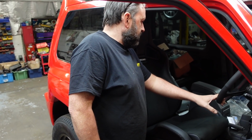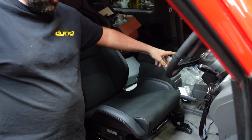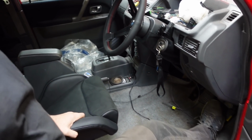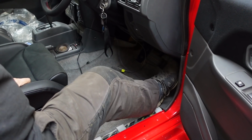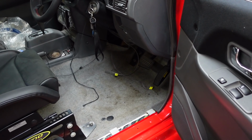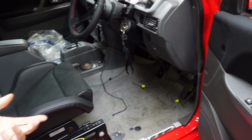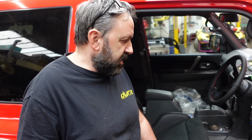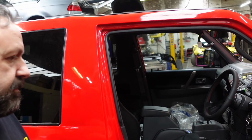So that's that done. Gear selector all works as it should. So that's got drive, park, everything all works right. GM pedals in. All feels nice and the right height. Getting the pedal at the right height and the right distance to the top is really important, because if you get it wrong, the pedal either feels too light or too stiff, or you don't have the modulation with your foot. That's something we see a lot in converted cars. They'll cut the pedal really short and it ends up stiff, and you've got no tip in, and it's just not very nice at all.